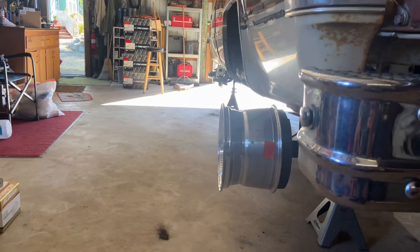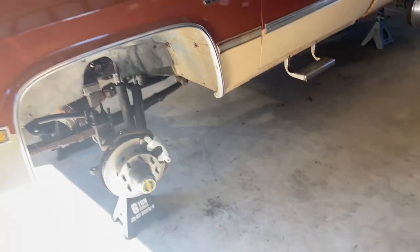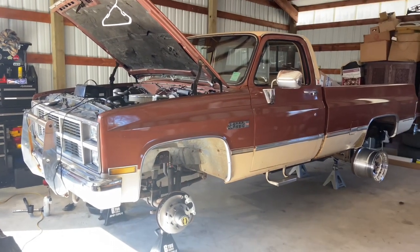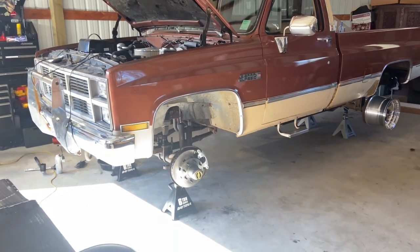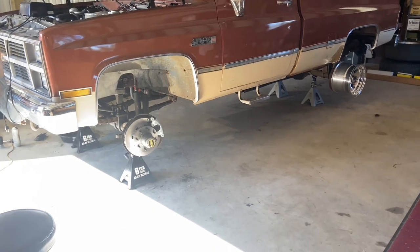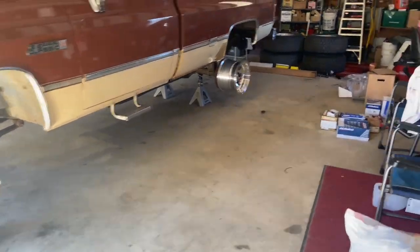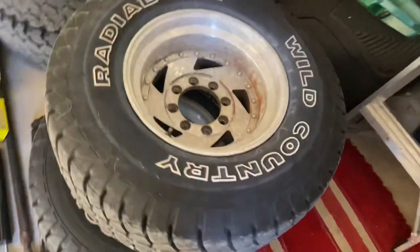And I think they're going to give us plenty of clearance up front too for the next item on the list, which is going to be some tires. Now, we haven't ordered that yet. We're thinking of doing some 315/75R16s, which is basically a 35-inch tire. This truck does have a 4-inch lift, so I think it'll be fine. I think it'll fit fine. I don't think we'll have any rubbing. If you know otherwise, please leave a comment and let us know before we drop a bunch of coin on those tires. Previously, we did have some 33x12.50s on here on the 16.5-inch wheels.